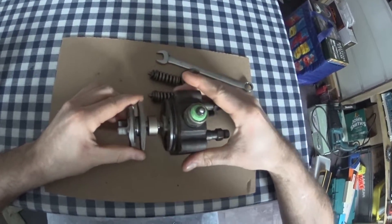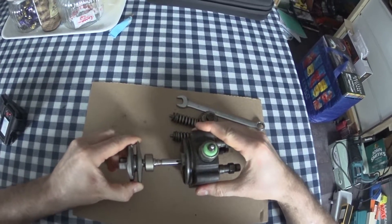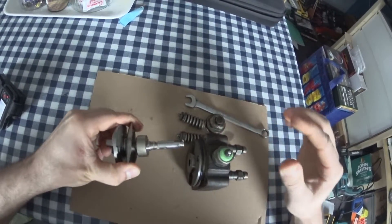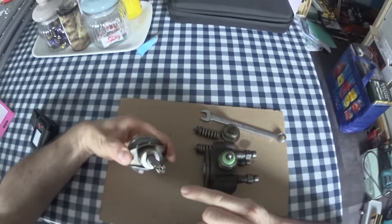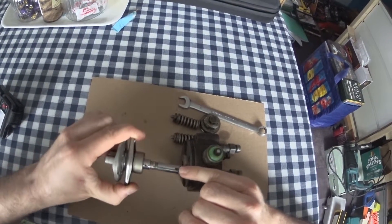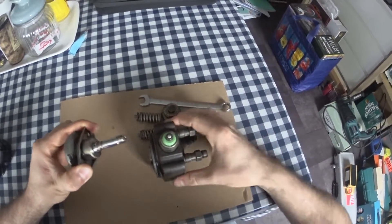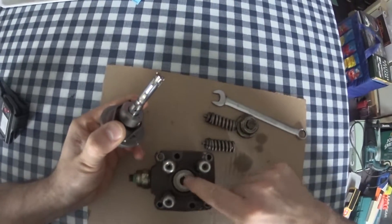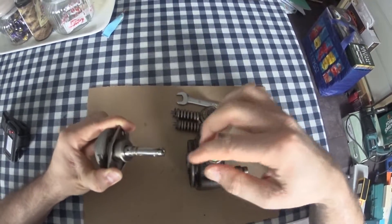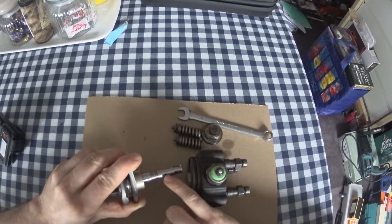When it's all in the pump, it's a lot closer together. Inside this delivery head, it's such a good fit. You've got four ports on the end there, and what they do is allow the fuel to come in through the fill port, around — because there's an annular groove in there — which then fuel flows through there, into here, and up to this delivery port.